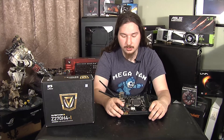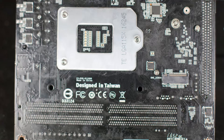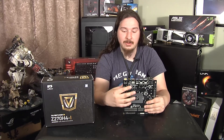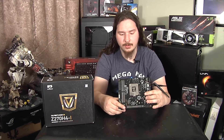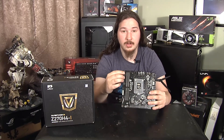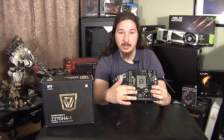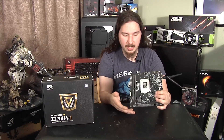Next, I want to talk about the actual layout. On the back there is a full M.2 slot that supports up to 80mm cards. An interesting fact is that all Z270 motherboards support the Optane SSD from Intel. However, I'm not a huge fan of this slot being on the back of the board. One concern is clearance — not all cases have enough height clearance, so this slot could make contact with the back of the case, especially if there's no cutout for a board this size.